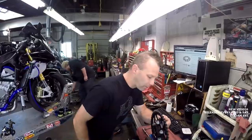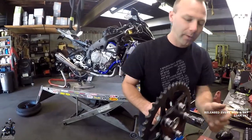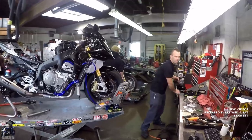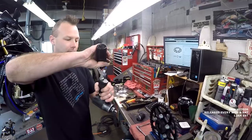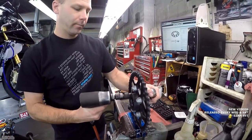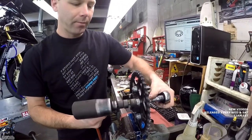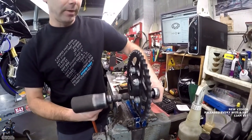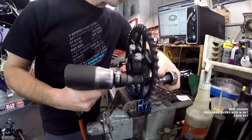Yeah, no kidding. We got to hold the back part because it's actually a bolt and a nut setup. A lot of times these are just a stud and you don't have to hold the back, but from the BMW, we have to hold it. Going up in a star pattern. Probably doesn't really matter, but that always keeps any material from warping when you tighten or loosen. Cool. If you go in a star pattern.